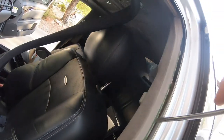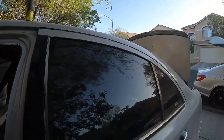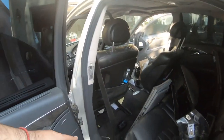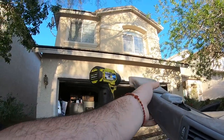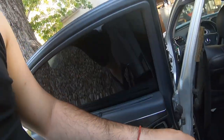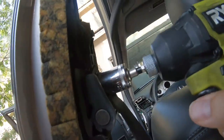There are clips all around — I'm going from around the other side and just start popping them. Mine is really destroyed because it's a California car and has sat in the sun for a good amount of time. We also have to remove the weather stripping and the kick panel on the bottom. Once all that's off you can see the seat belt. We need to unbolt it from up here and then remove it down there, and then we can take the whole thing out.